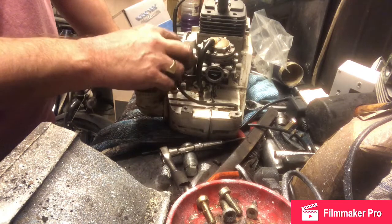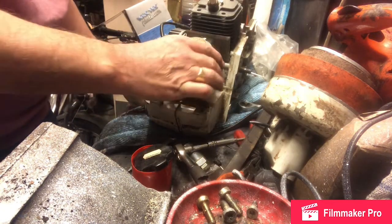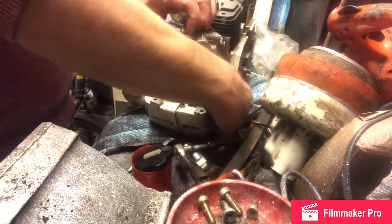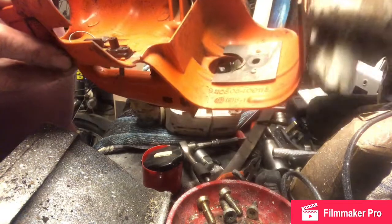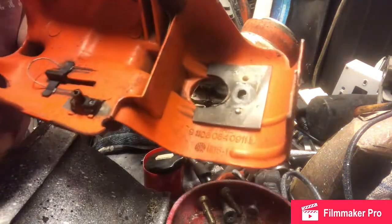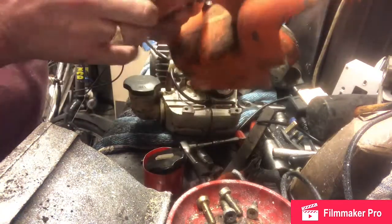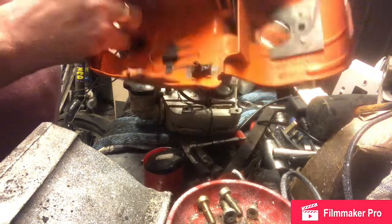I think we're getting near the airbox stage. One thing to remember is always put your carburetor on the correct way up — it should be facing down. Before I end this video, I just want to go through something I've been asked to do. I've got the cover here for the Stihl saw — there is a part number there, hopefully you can see it on camera. This is the throttle rod: as I squeeze the trigger, that rod moves up and down, and then this one obviously is the choke.